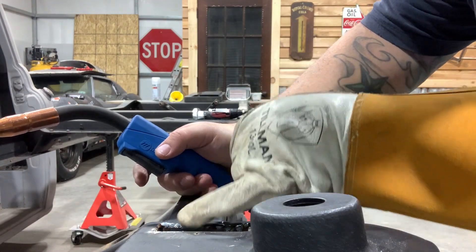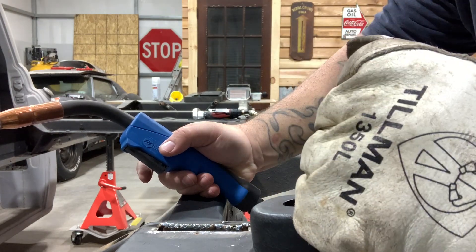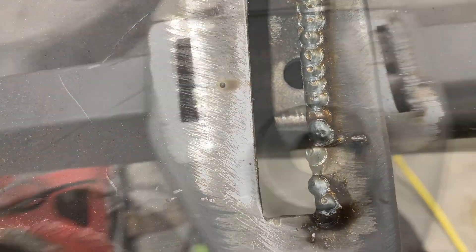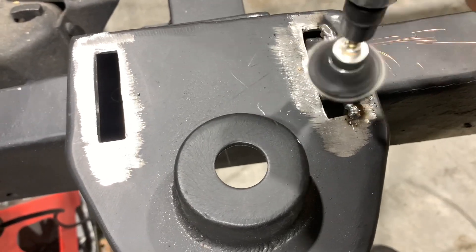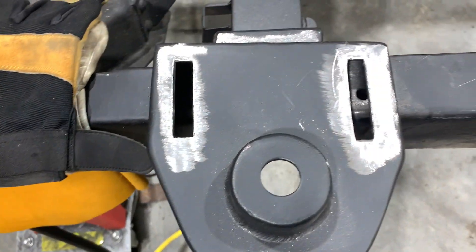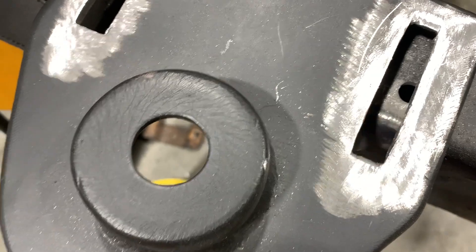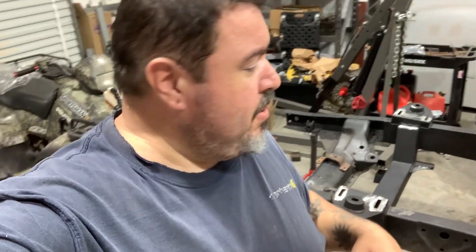So it half went well — on this end I accomplished exactly what I was trying to do, and on the other end when I was getting started I had some puddles fall over. There's going to be some more grinding ahead. We are welded in on both sides, ground down nice and smooth. Our T-bolts fit and they do not turn — exactly what we are looking for. I'm going to shoot a quick coat of paint on it to keep it from rusting, and then I think we're going to take out our control arms and start locking them up and take some measurements.